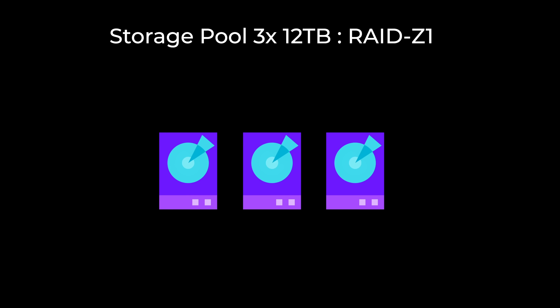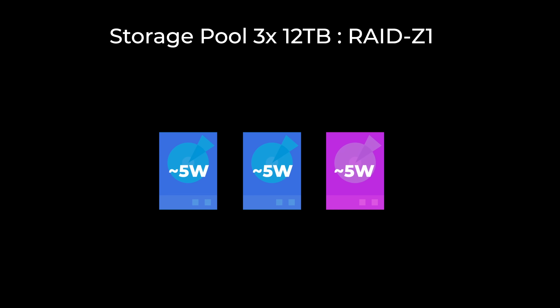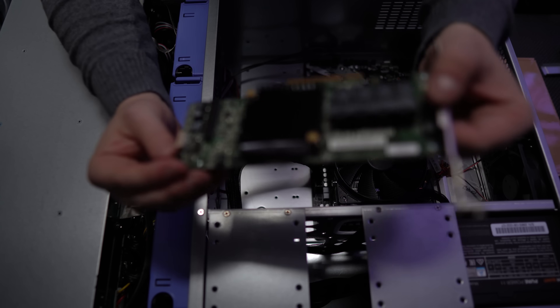For example, I built a striped RAIDZ2 pool of 12 drives, meaning only eight drives used for storage while four are wasted just for redundancy — but still consuming power. Now I think it would be smarter to put just three or maximum four hard drives in a RAIDZ1 pool. Three 12TB drives in RAIDZ1 gives you 24TB of storage but only the power consumption of three drives instead of twelve. It might be slightly slower, but you could also invest in more RAM for caching, or add an NVMe SSD as a cache volume or fast storage pool. It was a great but expensive learning experience.